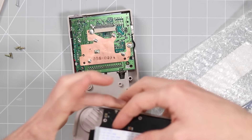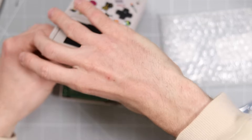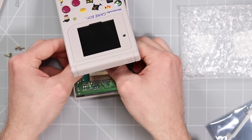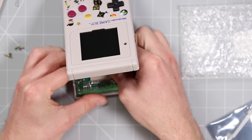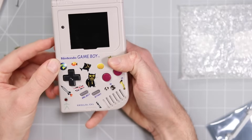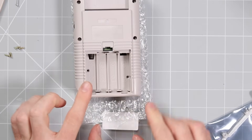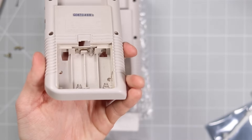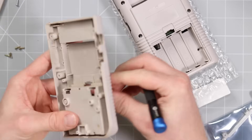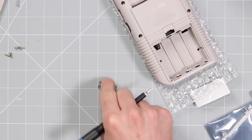Now what we can do is take this whole front assembly and connect the ribbon cable, which is quite a tricky thing to do but I think this is the best way to go about it. That is now looking like a Game Boy, but what we need to do is put some power into it and see where the screen's alignment is. These contacts are all a little bit dodgy — this one at the top is okay, but these bottom two are pretty dodgy, so I'm going to try and find some better ones.